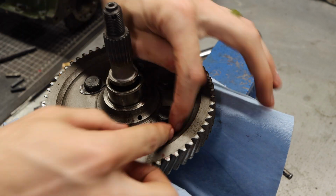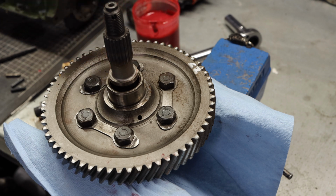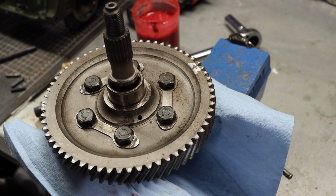All right. Now with all that torque down, we're going to bring these lock tabs up. That's kind of a pesky part. And then with that, we'll actually be able to move it over to the gearbox and start setting our preload.